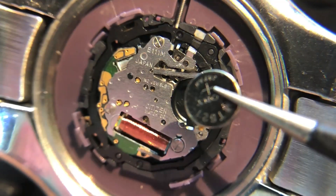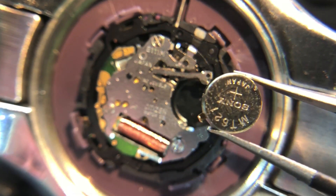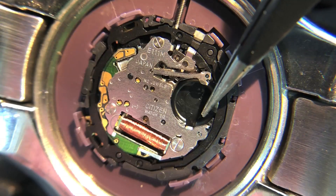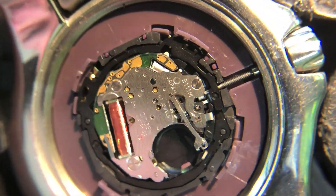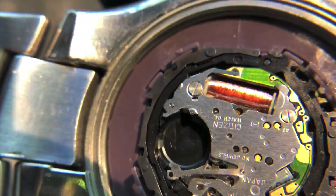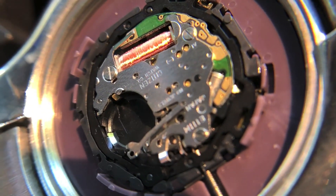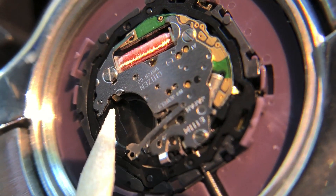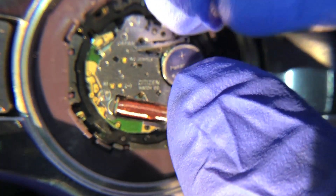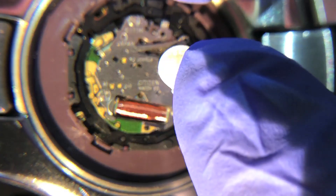You're not going to hold the new battery with the tweezers like this. See the little bronze nub on the battery? That's the part that goes into the slot on the movement. This little slot right here — that's where that nub came out of. Take note of that as you remove the battery so you know exactly where it goes back. When you look into that slot you can see a little spring-loaded connector — that bronze spot is what connects with the nub on your new capacitor. Grab the new battery, line it up, and it only goes in one way. When you turn it correctly, it falls right into place.